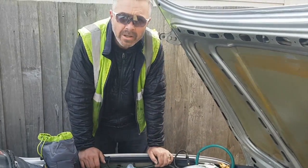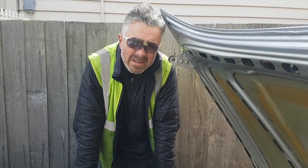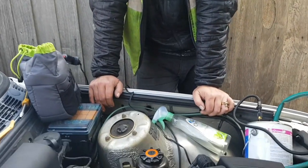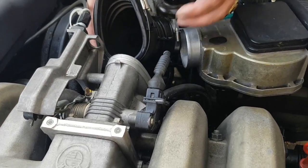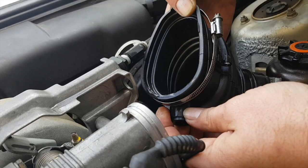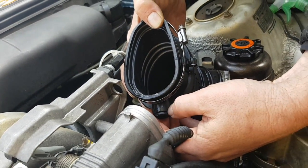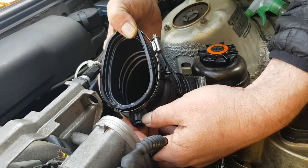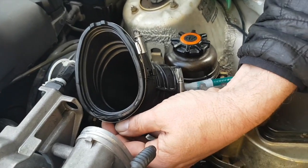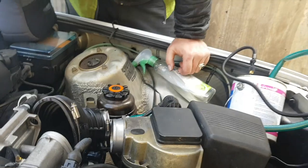All right, so I've got to get off to work. We've already found one giant leak. Yeah, it's a pretty good one. You can really hear it once the compressor's off and it's just going. We think it might be here, this is just some sort of bung, and that could probably do with a combination of some RTV silicone, and then either a decent zip tie or a clamp on there. But obviously I'll leave this kit here for you and you can keep checking.